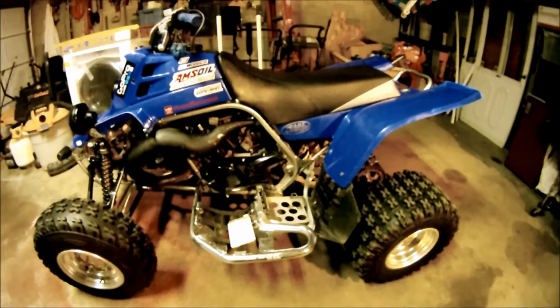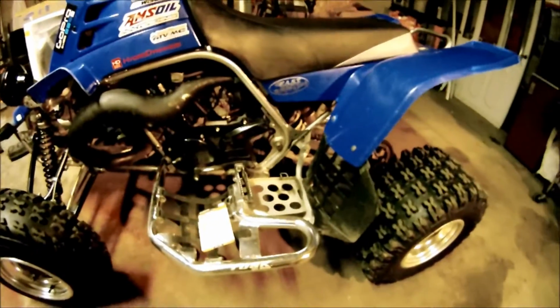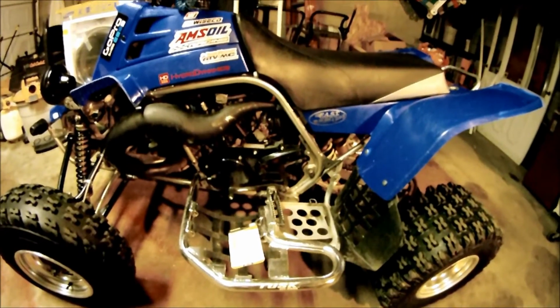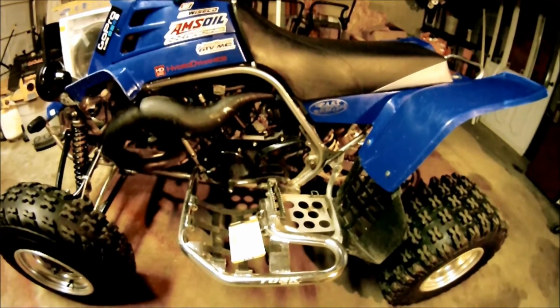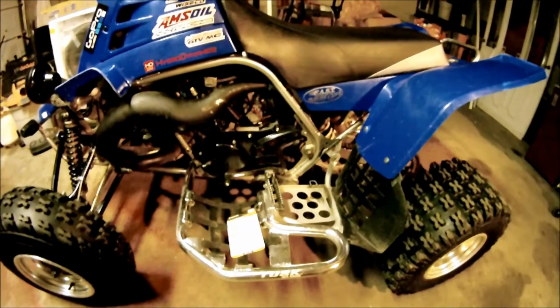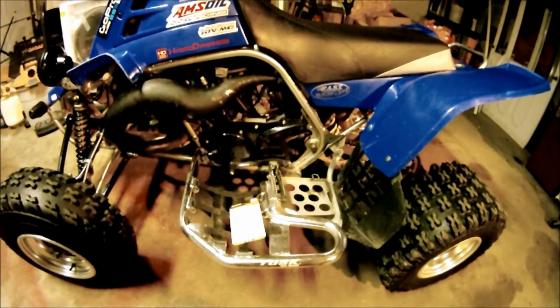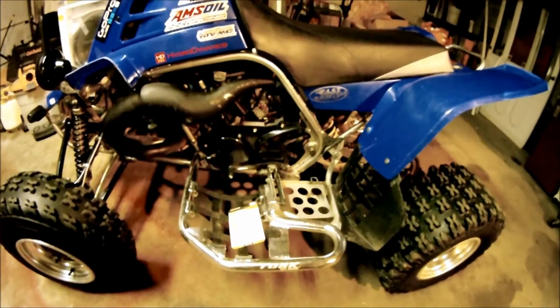This video is just more so an update. Some other videos I have coming out, I'm going to do a chain and sprocket switch, do a little re-gear since I have so much more power now than I did when it was stock. I think I'm going to go up one tooth in the front instead of being down one tooth in the front. So that'll be one more tooth than stock. Spread out the gears a little bit more, carry a little more speed on some of the corners and stuff. Don't have to shift as much.